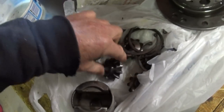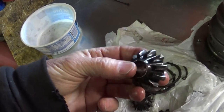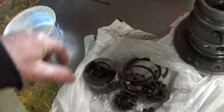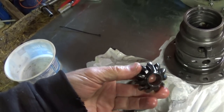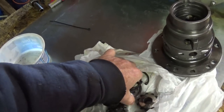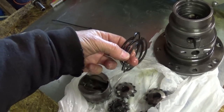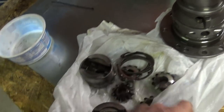It was locked up — it happened on level ground, just pounding. We were able to tow the car, which is the craziest thing. I always worry about differential failures creating a situation where you can't move the car, but it seems like you hook on a tow strap and get a little crunch. It could have been a tooth that started the whole thing. These are all used gears I pulled out of something else. I don't have tools to magnaflux or look closely — there could have been a fracture or crack. That started the chain reaction: extra material coming off and staying in the gear forces things and overcame the snap rings. By the time you tow it two miles back through the sand, there's so much damage — who's to tell what started it.